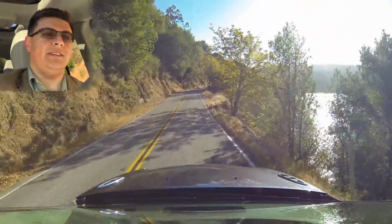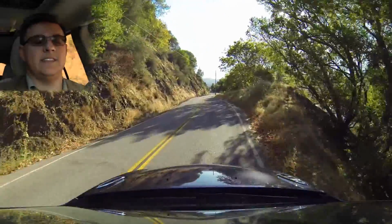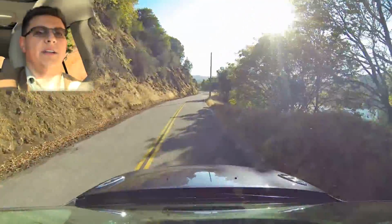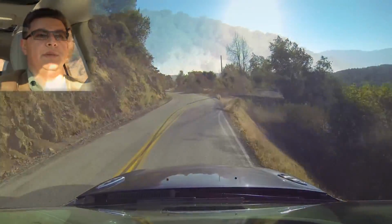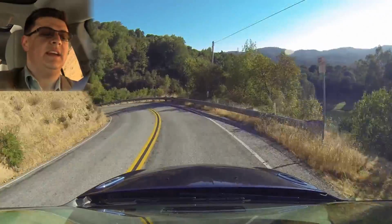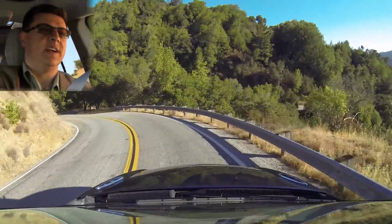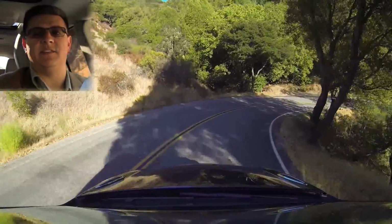In terms of braking, 60 to 0 in 144 feet is kind of long for this vehicle, and that's despite the fact that the tires are pretty wide. Again, it's really just that 5,000-pound curb weight that causes all that to happen. The curb weight, the fairly soft springs, and the high-profile tires mean that the Enclave isn't really a corner carver. If you want corner carving in your three-row crossover, then the Acura MDX is the vehicle for you.